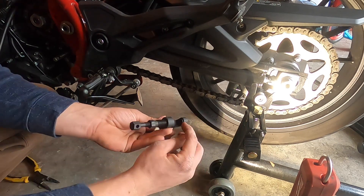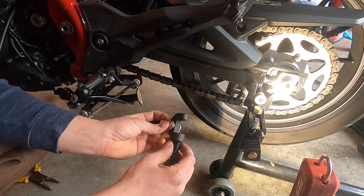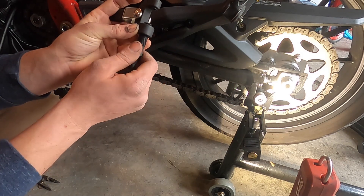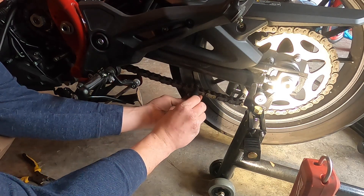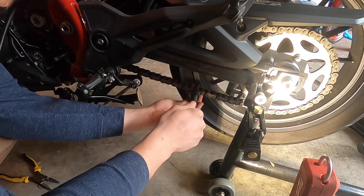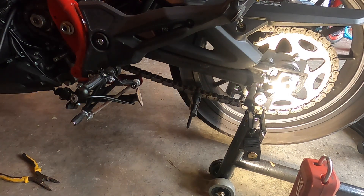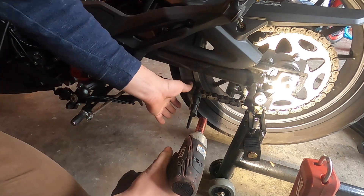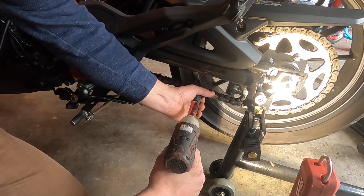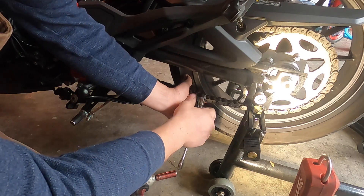So we're going to push a pin out through one of these holes. This one right here operates that little stud that comes through, and this operates the thickness of our chain. So we're just going to come through, line it up, get everything on there, all nice and good. Just tighten that up. We're going to take our wrench and we're just going to tighten — we're not cavemen, we have technology.